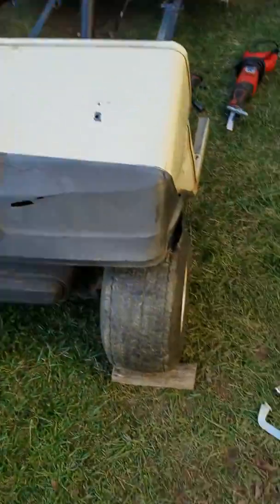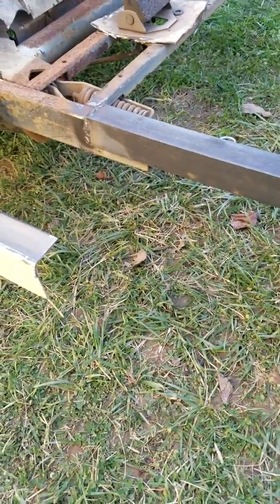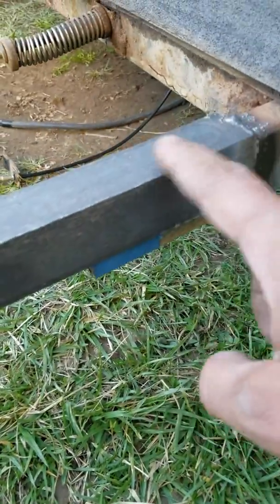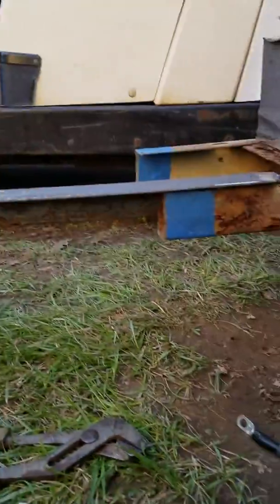Okay, after much consternation and oopsing, that actually happened the first day we got it, we've gone ahead and chopped and stretched. And we've gone with 1.5 inch angle iron onto the 1x2 frame. And what I'm going to do is actually put 1, 2, 3 bolts on each corner, just to shore it up, just to make sure that nothing is relying on just these welds, my spectacular noob welding skills. And as you can see, I did not weld them on the inside, so there you go.